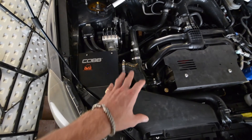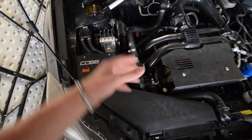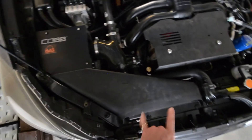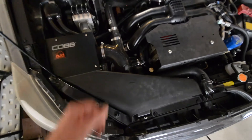The turbo kit is internally gated, but with the exhaust that I have, you can hear it dump into the exhaust. To get the factory air duct to fit, you do have to cut under here a little bit — super easy. It still bolts on with the two clips and is held on by one zip tie so it's not flopping around, but yeah, it serves its purpose.